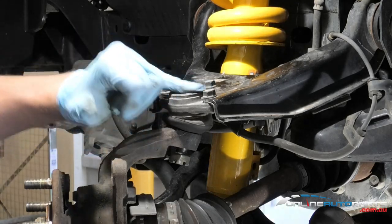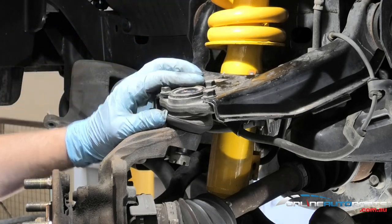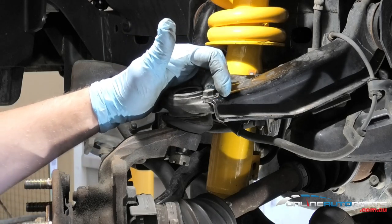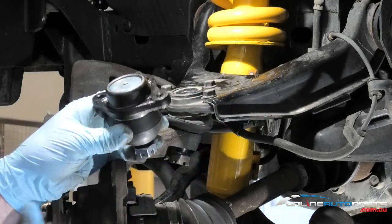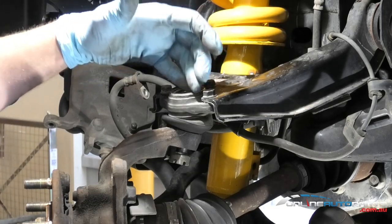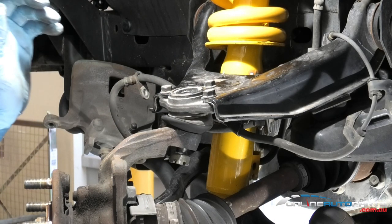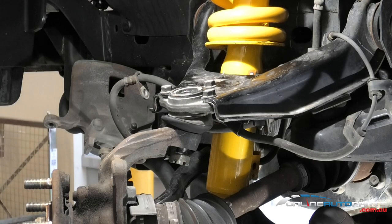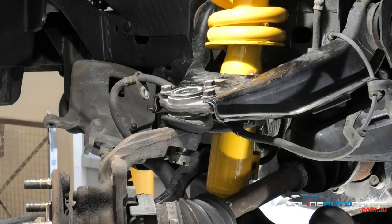On the top of this ball joint here, this is actually a sealed ball joint. When the manufacturer made this ball joint, what they've done is greased it up. It's a slightly different design on the inside compared to this one here, which takes a grease nipple - which is what we're replacing it to, so we can service the ball joint. The inside has a little nylon ball and cup socket, with grease sealed inside. Once it's fitted, there's no servicing - it's just a matter of when it fails, it fails. All ball joints will wear and fail, whether sealed or greaseable. With the greaseable ones, keeping up the service interval and keeping grease in there will give you a much longer life.